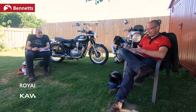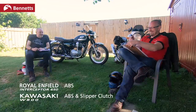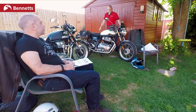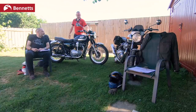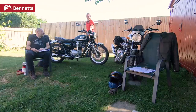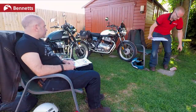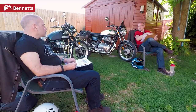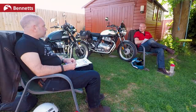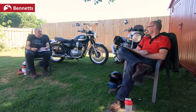I've got ABS. I've got ABS and a slipper clutch. The slip-assist clutch should mean a lighter clutch pull, and my hand is calibrated — the Enfield clutch definitely feels heavier, making you wonder what the W800 would feel like without it. Slip-assist clutches use a different basket design allowing lighter springs. I didn't get to the stage where the rear wheel was going to lock up on downshifts. The W800 has two trip meters versus one on the Enfield, plus a fuel gauge.